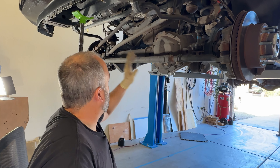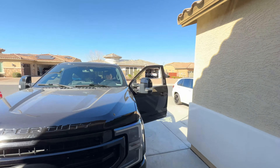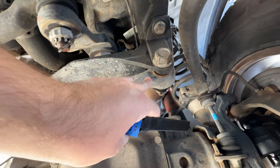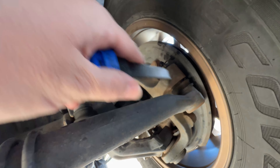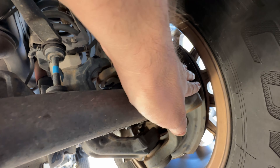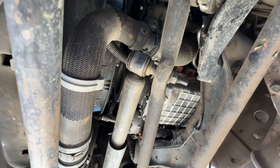Realistically, the best way to inspect the ball joints and bushings on this truck is on the ground while under load. I've got my helper in the truck and he's going to steer left and right in short bursts so that I can see what's going on at the ball joint and bushing level. When we get under here, we're looking specifically to see if these bushings are moving. You can see this one is slightly pivoting in and out. Over here we'd be looking for up and down play. If you feel it, that's the easiest way to do it. That feels okay. Let's go to the other side — we'll check up at our shock, looks all right, and then hit the stabilizer. Not too much movement there.